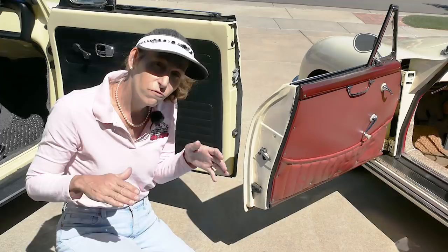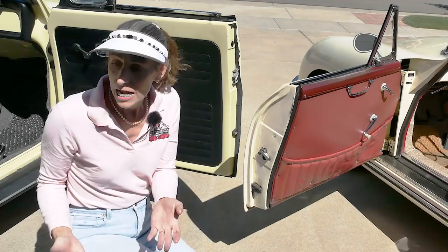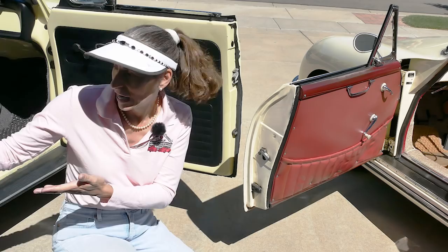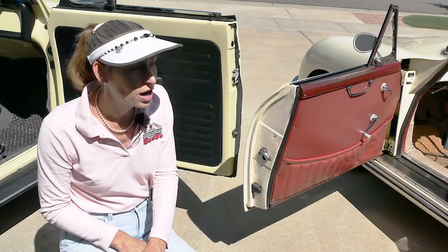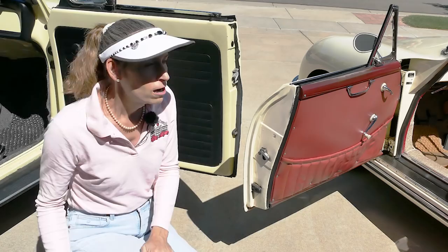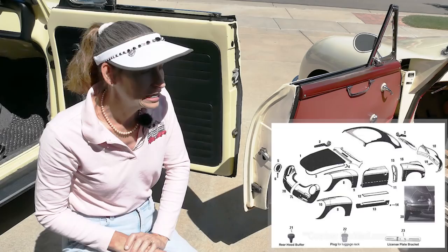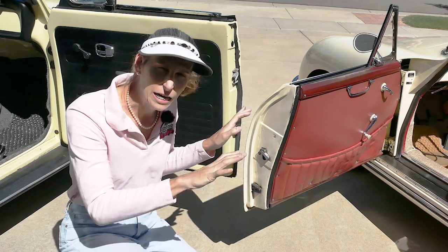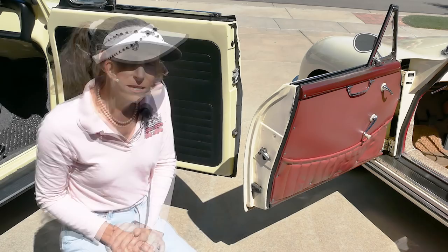For the Beetle it's a very different story. It's made from a flat pan where the running gear is all bolted to it, the engine is bolted to the back, and the body is dropped on top and bolted all the way around. This modular design is specifically to make the car easy to work on — if you dent a fender you can unbolt it, buy a new one, get it painted, and put it on. With the 356, the whole clip has to be cut off the car, a new one welded in, and reshaped — a huge pain. They did this because the 356 was designed for aerodynamics and to be as light as possible. It's actually about nine inches lower than the Beetle, giving it a much lower center of gravity.